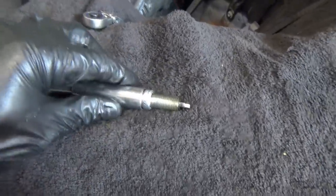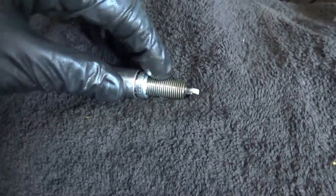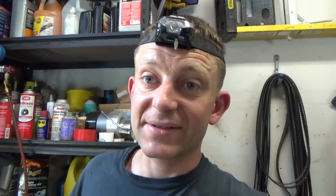I got the number two spark plug out. One thing you want to do if the car is unfamiliar to you and you weren't the last person to work on it is make sure the spark plugs are torqued properly. First try to loosen it; if it loosens right up, go back and tighten it and see if the crush washer has been compressed sufficiently. I can't count how many times I've seen a DIY spark plug change where the crush washer is not crushed and they don't torque the spark plugs properly. If your spark plug is loose you can have leakage — that's not good. I found spark plugs loose in all four cylinders when removing. We're going to torque them properly and then get a borescope in cylinder number two.